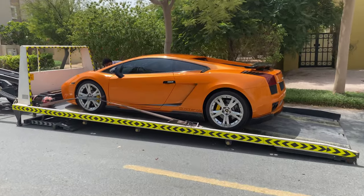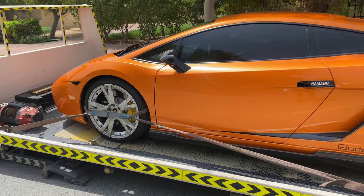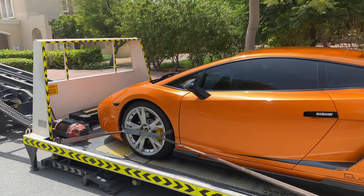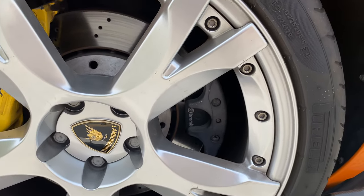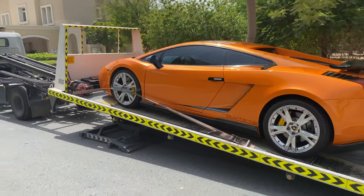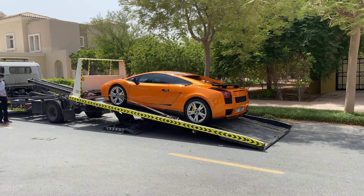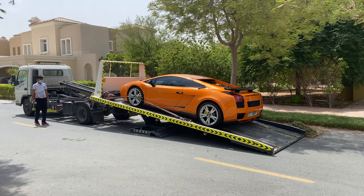As you can see, it's all strapped down tightly. I didn't put it in gear, just in case when they start it they might start it in gear and drive forward - we don't want that. It's secure enough, handbrake is on at the back - that's the Brembo brake handbrake. That's how you get a supercar on a recovery truck - you can just drive on normally and then it goes up like that, so you're not scraping anything.